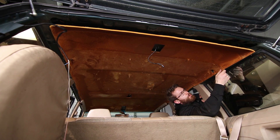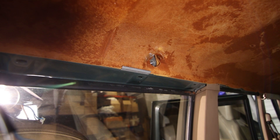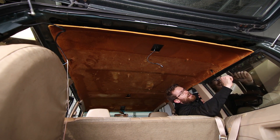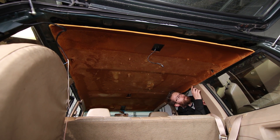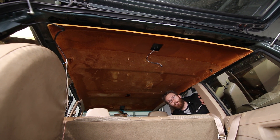At the back right here, there are two metal supports that hold up your rear speaker panel, so you're going to have to get the headliner out from around that. Then you're just going to have to release it from the screw mounts that come off of the sides. Once you have one side loose, you should be able to start pulling it out.